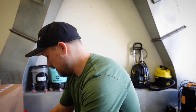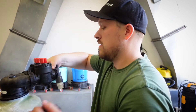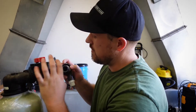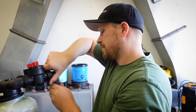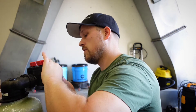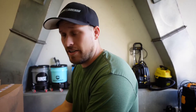So the resin's in it. Secure it nice and tightly. Then you have these two valves here that go on the end. Now when I got one of these the o-ring was kind of off kilter, so you want to make sure those are in there correctly or else you're going to have leaks. Okay, we're going to get these on nice and tight. Everything maxes out really nicely so you know when it's tight — you don't have to over-tighten it, it has little stops on there.